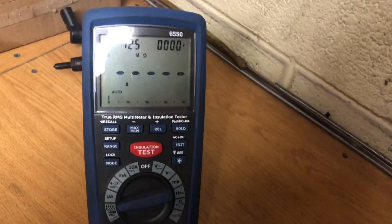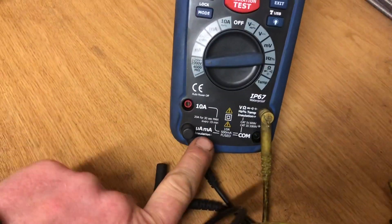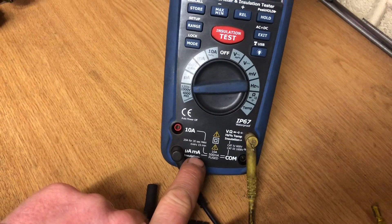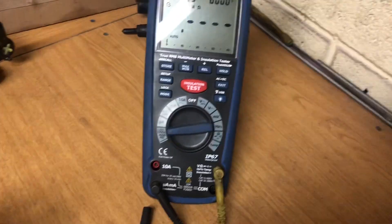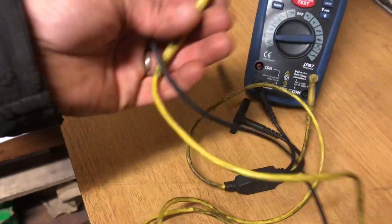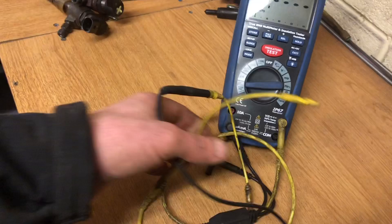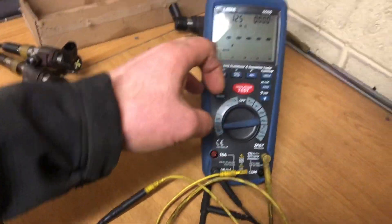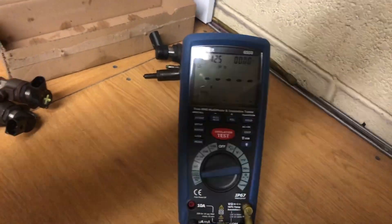Anyway, the laser insulation tester is actually not too expensive to buy - that's a step-by-step on how to use it. You can see here where it's testing: insulation negative and insulation positive - these two pins are where you put your connector blocks. What I also find handy is using leads off a scope, just because there are banana jacks on the end that you can pop in and out, rather than the pointy pin probe of the insulation tester. Insulation testing piezo crystal injectors - hope it's helpful to someone, thanks for watching.